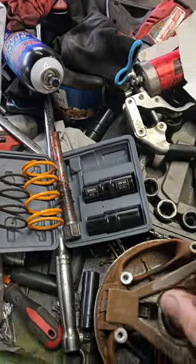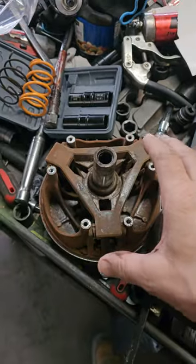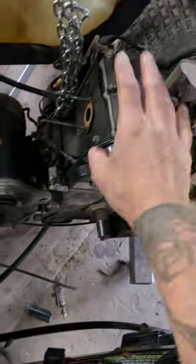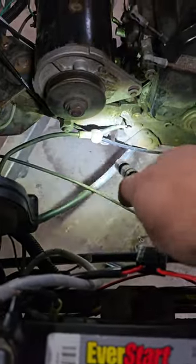I've been watching YouTube everywhere trying to figure out how to pull off the primary clutch. I got it off — everyone says you have to pull the engine. I pulled everything off the engine, but you don't need to do that. All you need to do is loosen up these two 16mm bolts right in front of the motor mount.